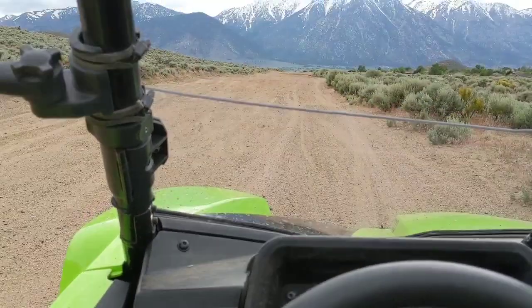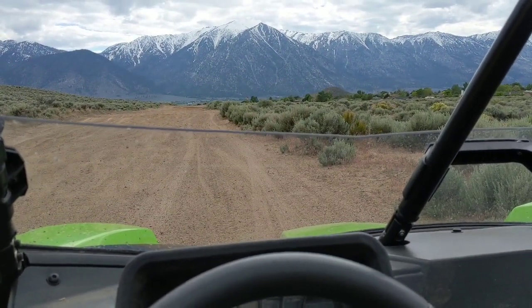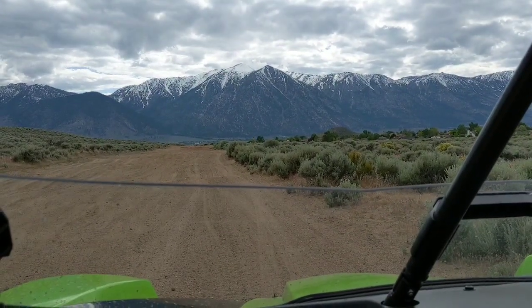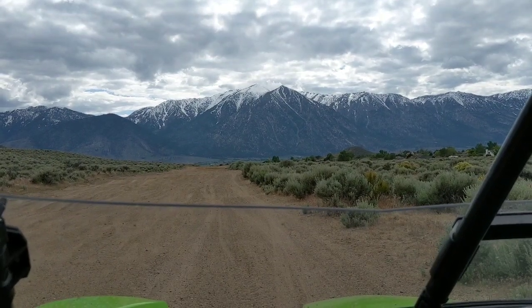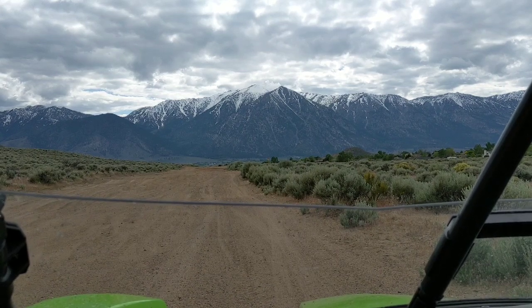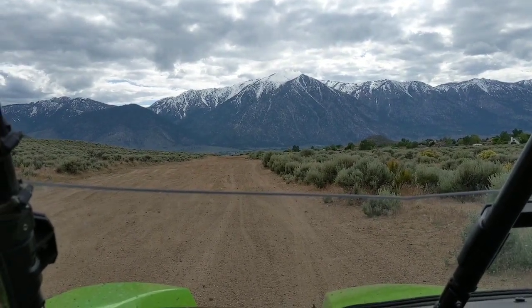I removed one link and strapped up the other, and I think I might still be hearing the sway bar either moving side to side or up and down banging against things, but it's definitely the main clunk that I was after was definitely deleted by that. And it's been about, geez, I don't know, eight months or so, I'm guessing, since I replaced the front sway bar with a 19. And I kind of forgot how well this thing handles without it.